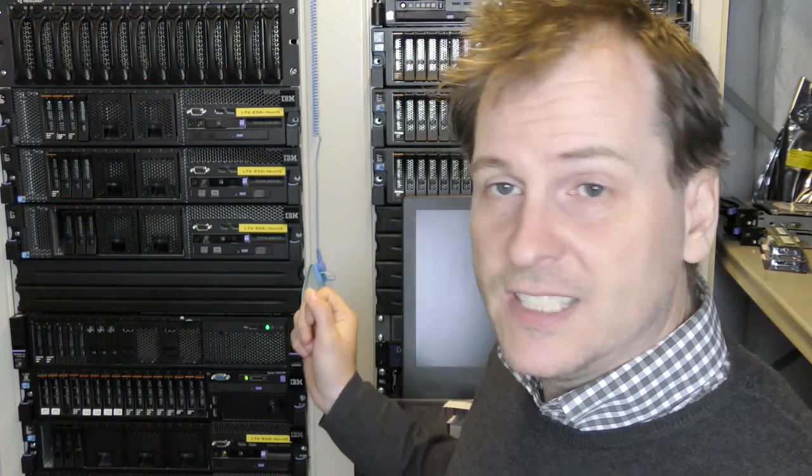I set it up with ZFS instead, making each of the drives go through the RAID controller and being presented to the operating system, and then letting, well, the operating system is Proxmox, and then letting Proxmox handle the disks and making this ZFS drive in there. Probably fine and all and good, and well, it works just like a RAID 5, but I really like my RAID controller in there, and it's a really high-end piece of equipment, and just passing everything through and using some software RAID in there, well, it feels wrong to me.